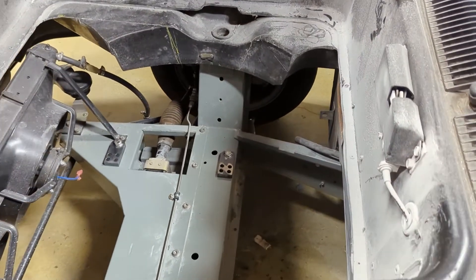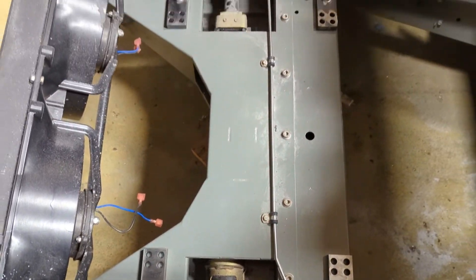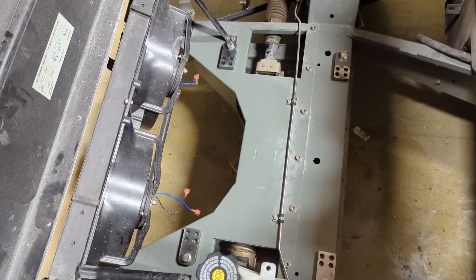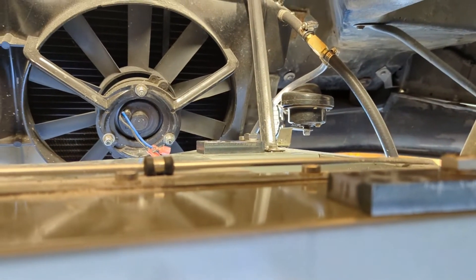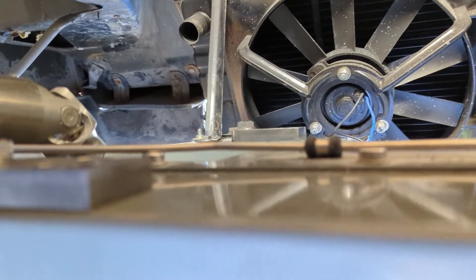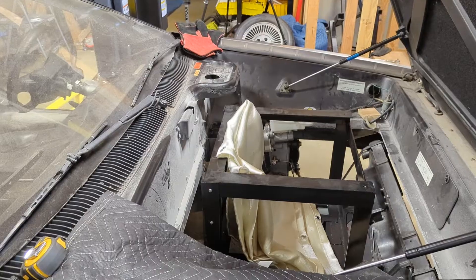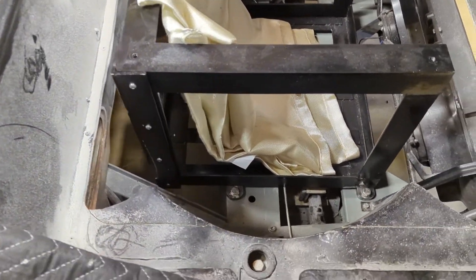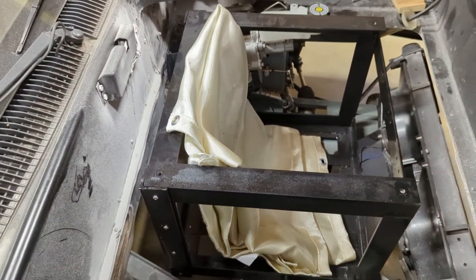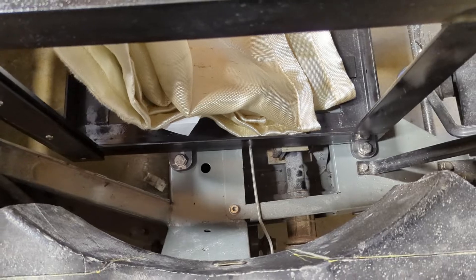I drilled those holes, then put a bolt through each one and went underneath and put a nut on the other side, so each one is now fixed in place. Now I can place the battery box back on these fixed points and get them welded. Here is a side view of these little tabs — they're half an inch thick so that the battery box can clear the bolt heads that attach the front frame extension and the brake line that will run under it. I've put the battery box back into place, aligned right on top of our little mounting plates, and I've got the welding blanket positioned. Now I'll get these tack welded together with the flux core welder.